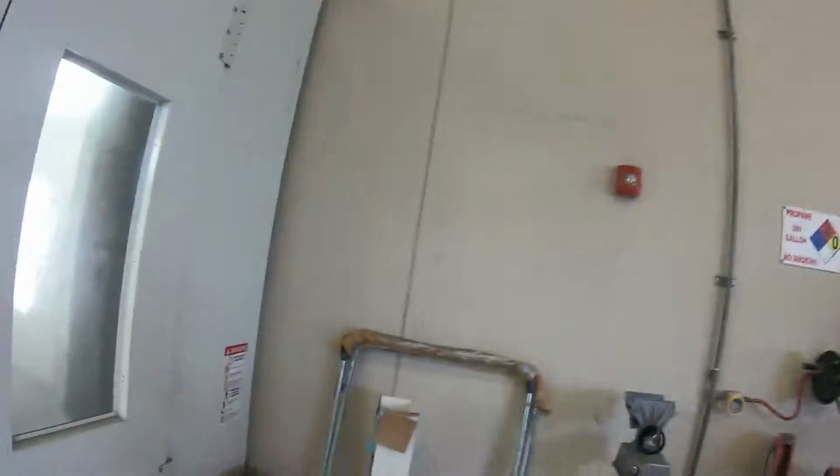It's a long process to do. It usually holds up the booth for a long time because we don't want to throw too much heat at it, because we've experienced solvent pop. Solvent pop pretty much is when you have a lot of material and then you're baking it, putting heat on it, and the top surface starts to dry, whereas the bottom is not yet dry, and little solvents are trying to gas out, and they gas out in the form of little dots all over the place. So we'll see how we do, and let's get this thing going.